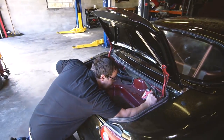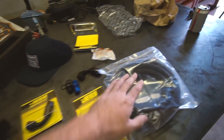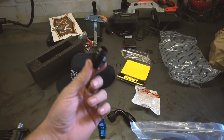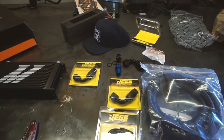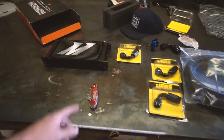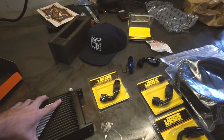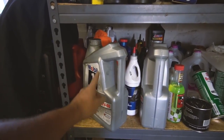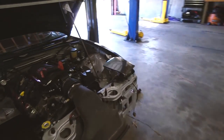The other thing we're doing is the oil cooler. I got a nice black Mishimoto oil cooler core, dash-10 fittings, dash-10 line, and specifically Mast Motorsports fittings for my pan — it's an LS conversion pan with built-in fittings in the side for an oil cooler or remote filter. I need to figure out how to mount it, make the lines first, and try to do it all quickly to lose as minimal oil as possible. I always run Mobil 1 15-50 and went to Walmart — they didn't have it in stock and it jumped from $21 to $27 per five quarts.